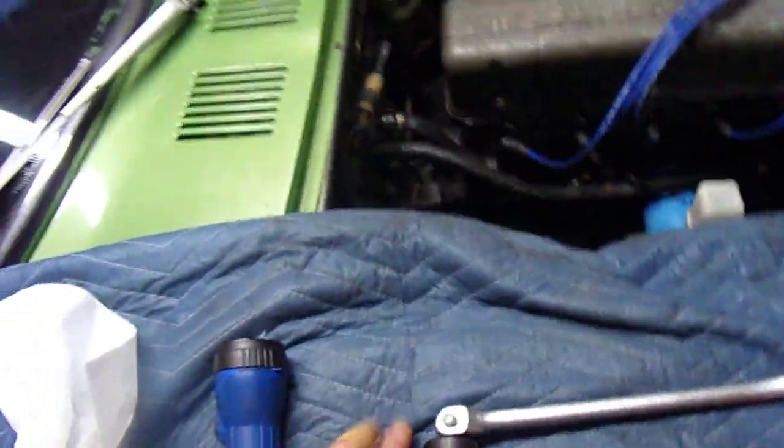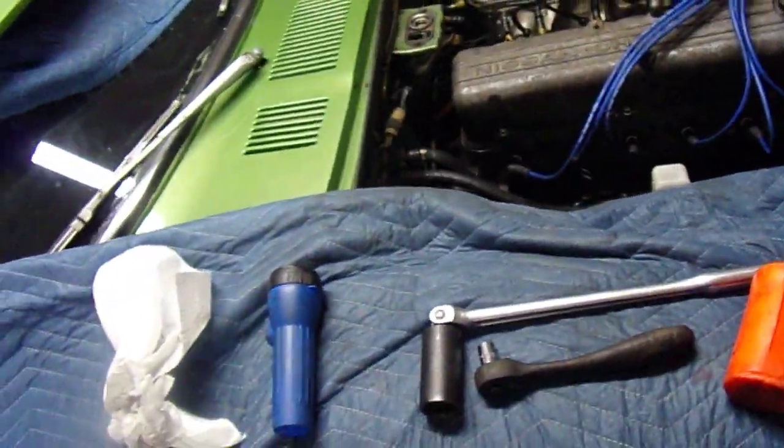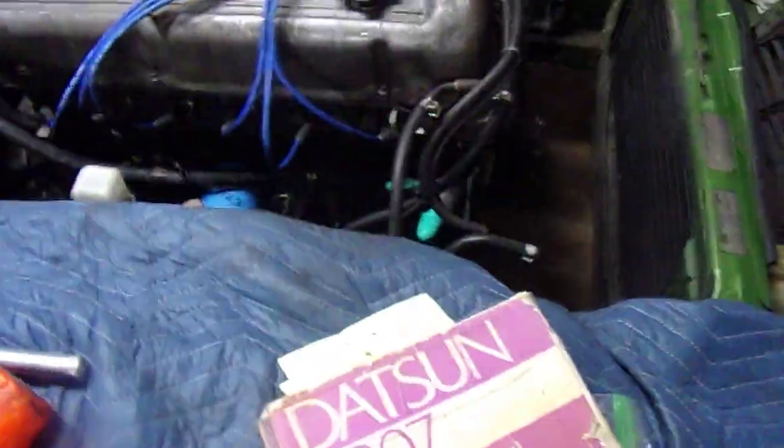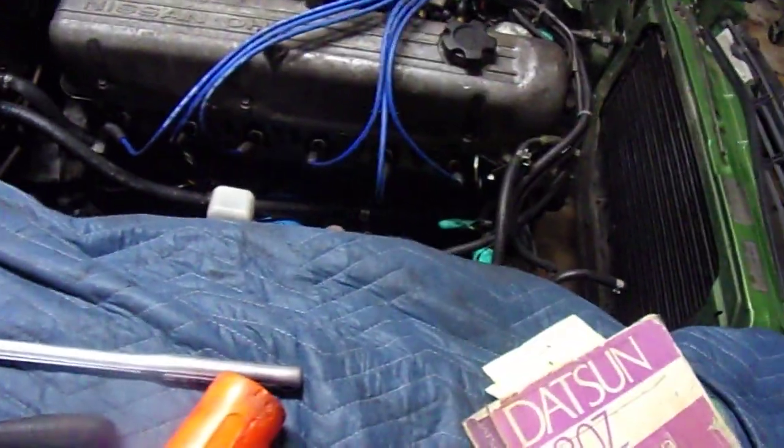It wasn't that bad. I mean, two or three tries and bang, it was in. I had Ian working the crankshaft with the 27 mil to move it back and forth, wiggle that to help with the input shaft mating into the clutch. That worked out real well, and it was no drama. The guide pins helped though.